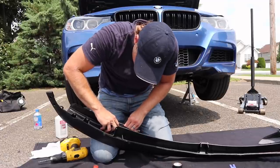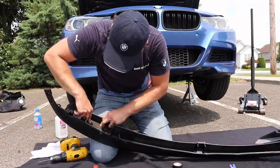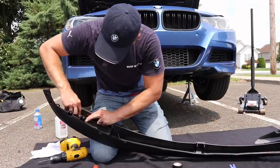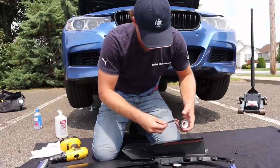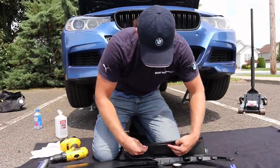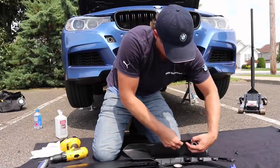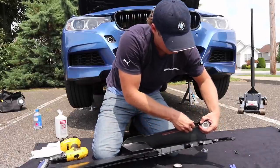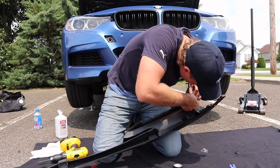After you've thoroughly cleaned the application area with alcohol, you can begin to line the lip with automotive molding tape. We'll leave a link in the description so you know the exact product that we used. Go ahead and apply two large strips, one across the portion of the lip that will be on top of your bumper, and another strip along the face. If you have any problems with the adhesive sticking, you may need to either sand the area down or use an adhesive promoter. We were able to use the molding tape by itself.